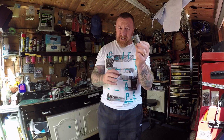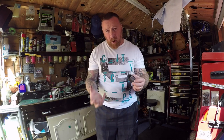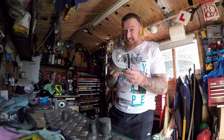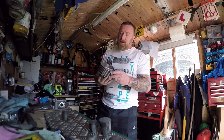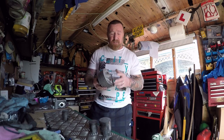I've had many pistons like this that break off bits of the bottom where it's just smashed, and they end up at the bottom of the sump. That's something you really need to clean out if you're going to change the head. Now, this is a 150cc - I say it again and again. This goes up and down really, really fast, and it will score. The reason why I keep saying, and I did a video on it - 70cc, don't do it.